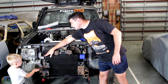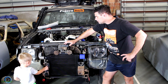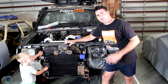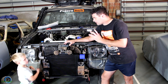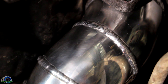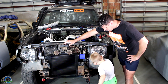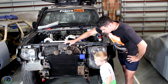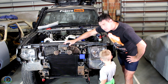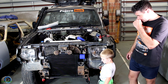Do you think Dave did a good job? No. I don't think my welds were the best — the metal was a bit contaminated and I should have sanded it back and prepped more. So now we're going to drill this side. Are we going to do it with a drill or are we going to burn it? We'll burn it. That means I'll burn it today. Now the real challenge starts — getting a bigger pipe into the engine bay, trying to avoid bad wiring, multiple aircon lines, a wheel well, a radiator, and without taking anything structural out.